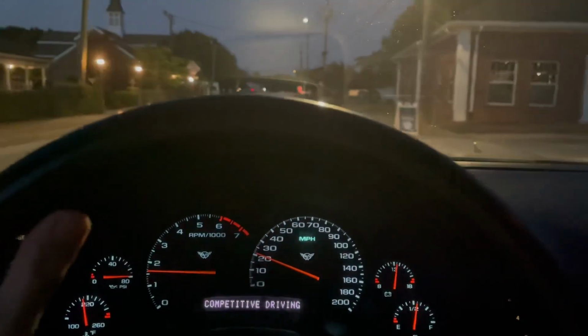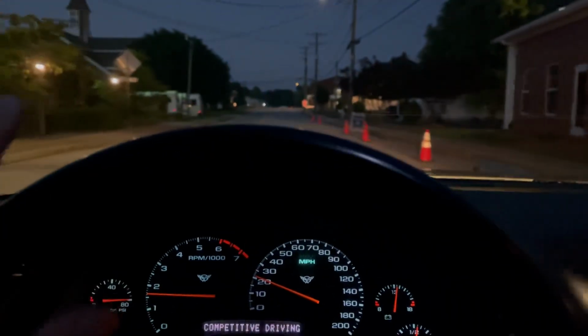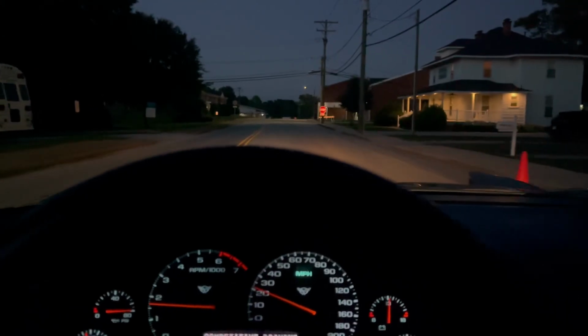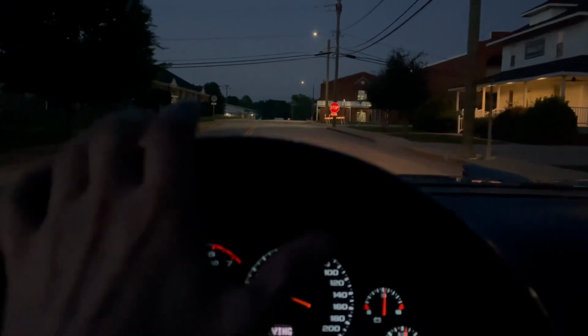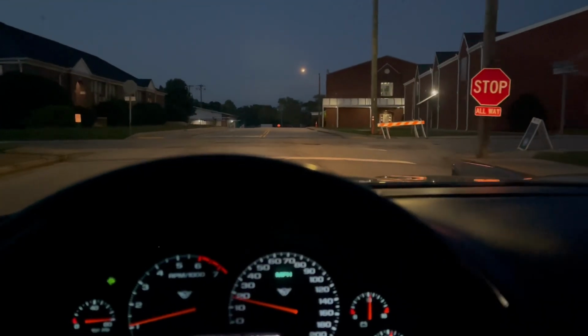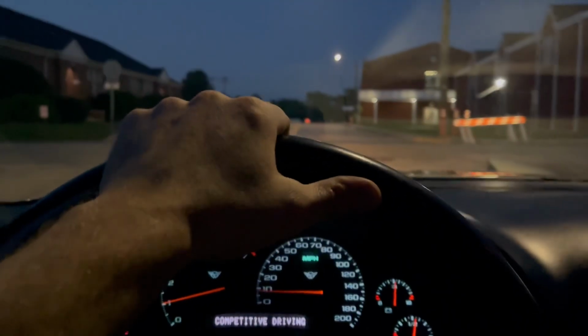Now my steering wheel is pointing a little bit to the left, so I do got to get an alignment, and that might help clear up some of the feeling while driving at interstate speeds as well. After changing the tie rods, the steering wheel's a little bit off, so I'm going to make a little bit of an adjustment in the garage right now. Maybe that'll help out, but alignment's always good. Well, the saga continues. At least we got a couple of tasks checked off the list this weekend.